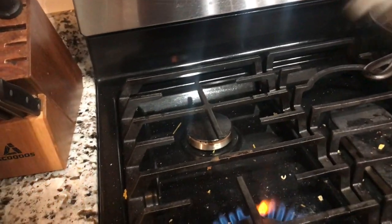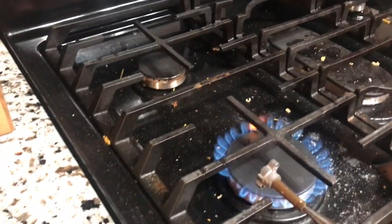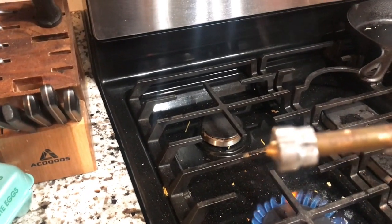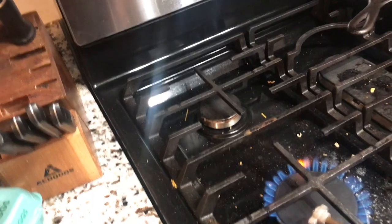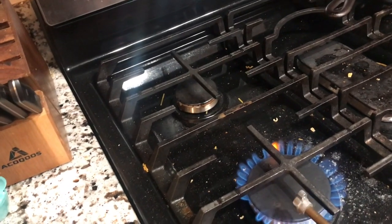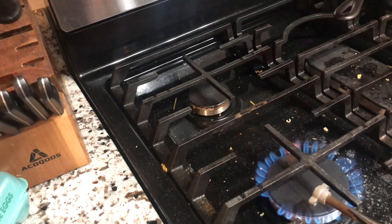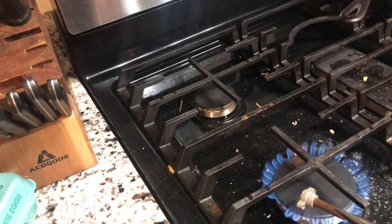I'll try a little bit of heat and some pressure — if that doesn't work I'll add more heat. It'd be nice if I could just buy a new part. This says zero-nine-one-zero, so if I lose those markings I know what my parts look like. Let me grab another pair of pliers and we'll see if we can get this to turn so our gas knob works better. You can use a blue blowtorch and a clamp; I just don't have one, so I'm using what I have.